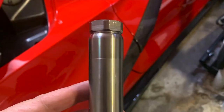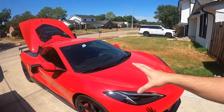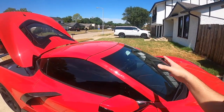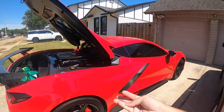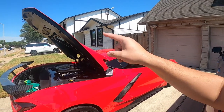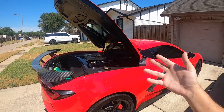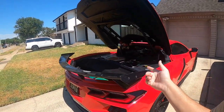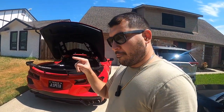We did try a few things to remove that check engine light. The first was using the 2M Fabrication cats, and those would work for maybe 20 miles. After that, the car would read the values on the O2 sensors and trigger the check engine light — only on the driver's side for some reason. I posted videos of all that in the past.